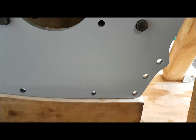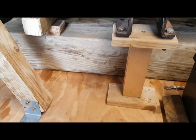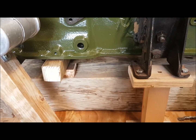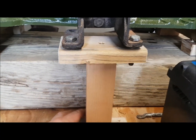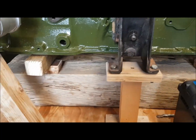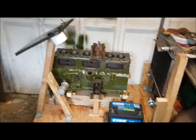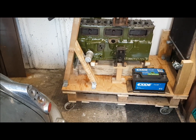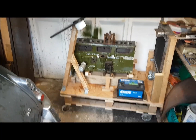I've made it so it's tipping the engine slightly forward so it sits better on the engine mounts, because it was slightly wonky. When the big support block is removed, the engine will drop probably about half a centimetre. I may have to pack it up — we'll just have to see — but I've left at least two centimetres of clearance for the sump, so it should fit. So there we have it — not bad for something made out of essentially junk and bits of wood.